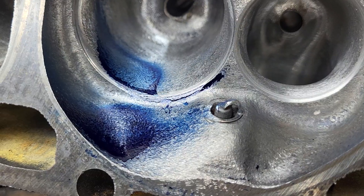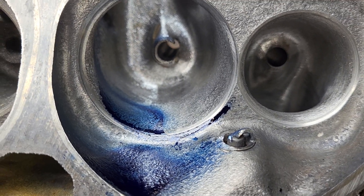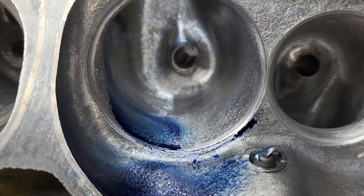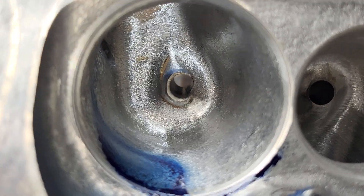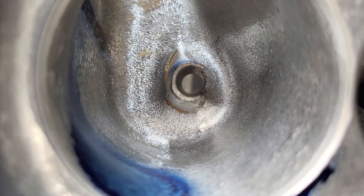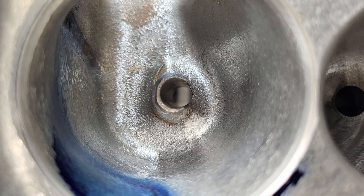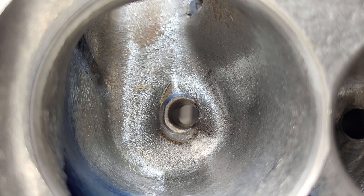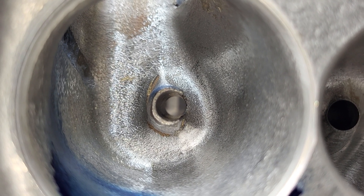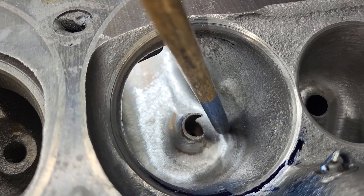It actually looks better from this direction. There's no swirl ramp at all and our liquid still stops in almost the exact same spot — that's really interesting. On this inside wall you can see I took a lot of metal out and moved that whole port over. I didn't take it to the point of making the bowl even around the guide; there's not enough metal to do that. But after where the ramp is, it's still relatively thick, and I have a smooth texture on that now.